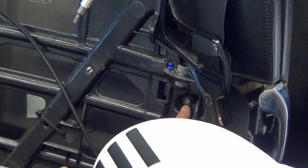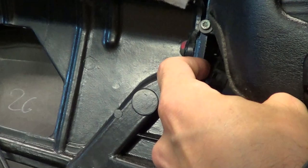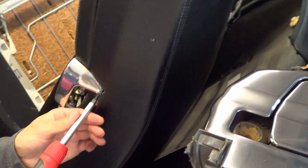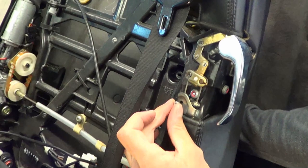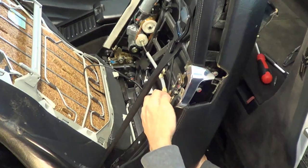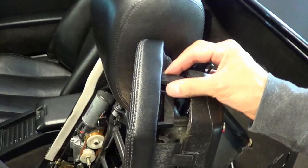We're going to focus now on removing this piece. This car has what looks like two T20 torx screws — there's one there and one on the bottom underneath. It's a tight fit but you can certainly get to it. There are other torx screws in there that I kind of missed that I'll need to take out — you'll see them on your own car. There's also this one right here — four torx total. With the four pieces out, this whole piece just lifts off and we can see the culprit.